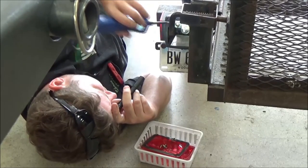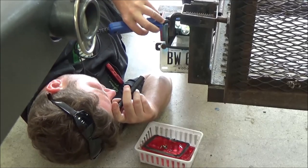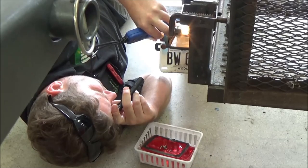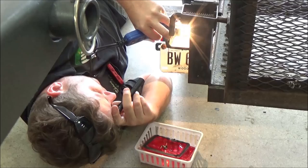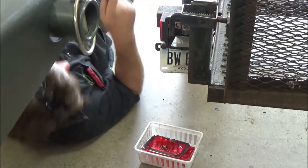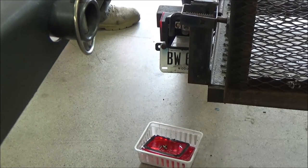I'm going to go right in here, get my supply voltage from the Power Probe, and test the light directly at the socket. I've got a dim light — that would be my tail light — and I have my brake light functioning here. Now I'll go test it all the way back up at the trailer connector to see if we fixed it.